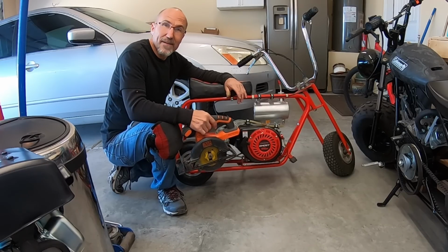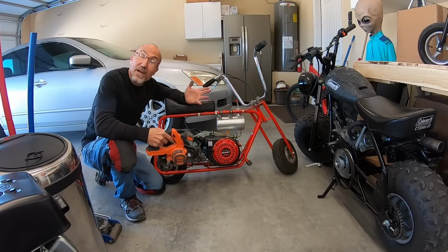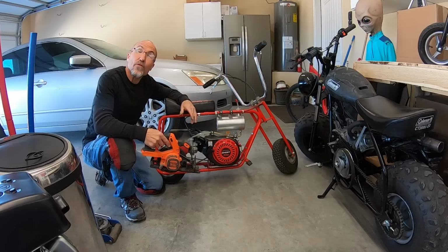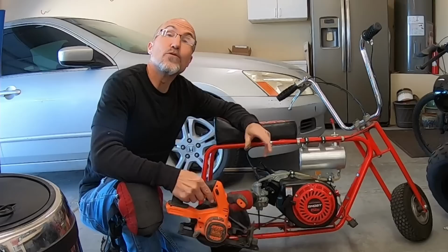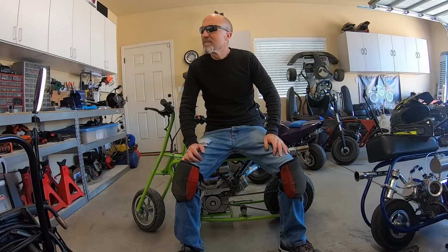So how did it run? It ran pretty decent. I mean, not quite as fast as before. Well, that's because you were running the long intake and the long exhaust without the dual spark plugs. You need to drill the head for 2 spark plugs. Okay, I'll have to try that.